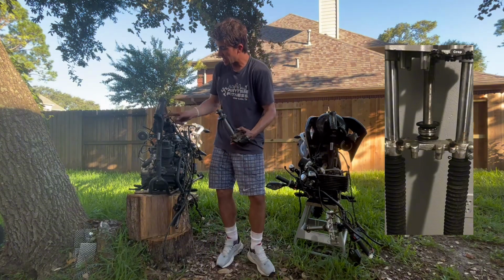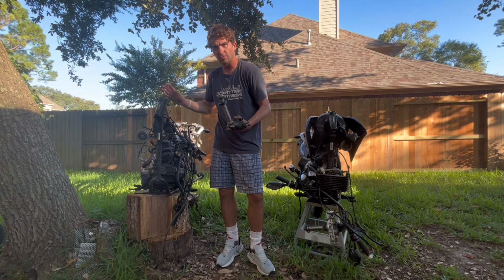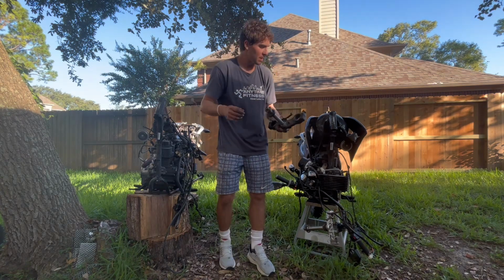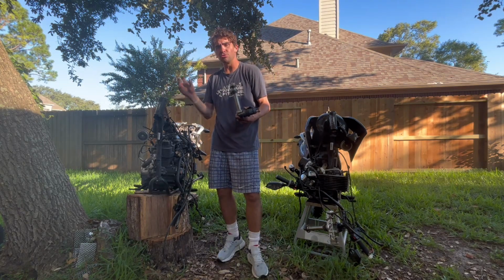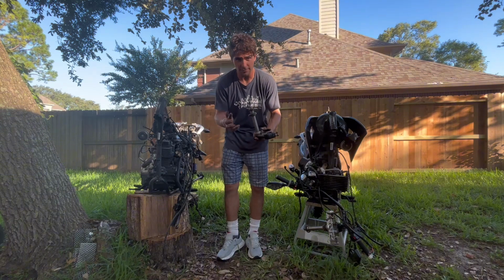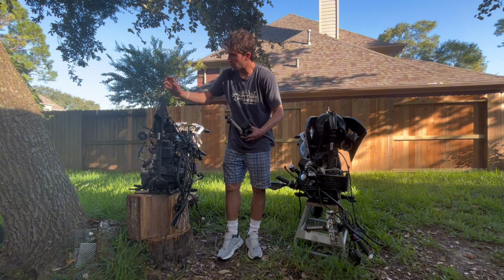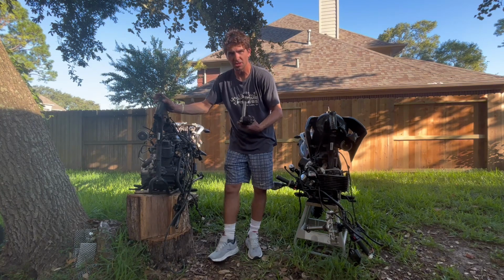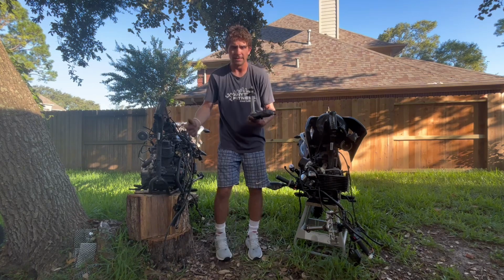Now this is the same neck from each bike, but you will need the races, the clear part where the bearing rides, okay? You have to pop the races out of the Hawk DLX. Use brass. Brass is soft. If you use a regular punch, you're going to mar it up, not good. You need to use brass. Be gentle. Everything when you're doing the bearings is gentle. You tap one out the bottom, one out the top.